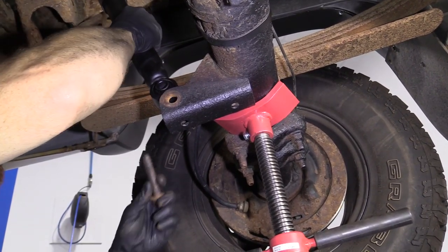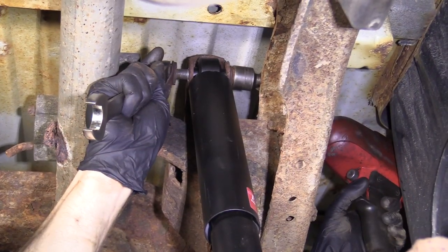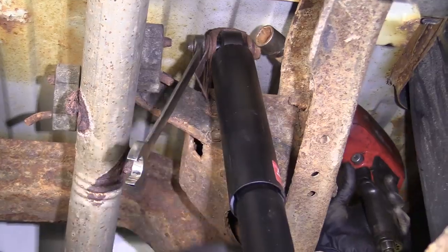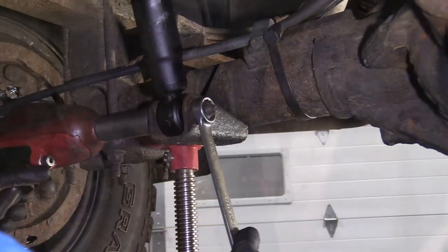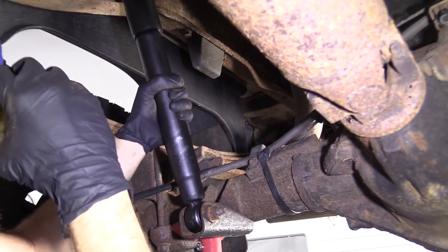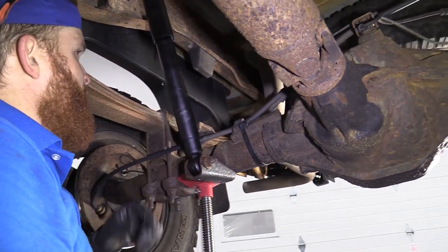You could also just do this — just give this a little squish, let it come down. We're going to have our shock bolt ready and just cut it right through the hole. We're going to get our 21 millimeter socket up onto that bolt up there. I'm going to grab my safety glasses. It's tight. Just try to wiggle it around — a little bit of movement, but that's just from our rubber bushing, which is great. That's perfect.